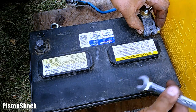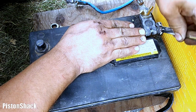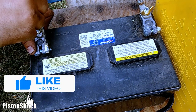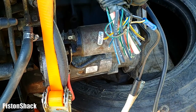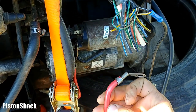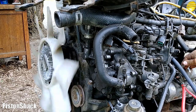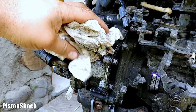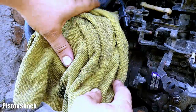Let's get our battery ready — pulled from my other Delica. Connect positive first, then negative — that sequence. Even though it doesn't matter out here outside the vehicle, better to do it right. I'm going to touch that control pin with the positive battery cable and crank the engine over. Let's try it. Oh — remnants of power steering fluid came off the pump. Let's put a paper towel and cover it with a rag — not a big deal.